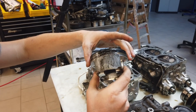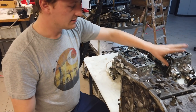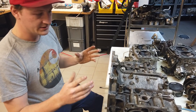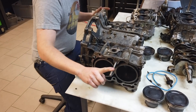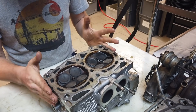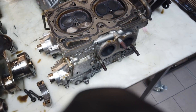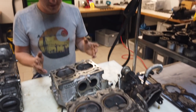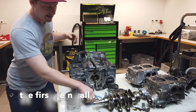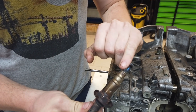What we have here is the standard piston ring failure. On cylinder four it's a little bit crazy because the engine was already opened before — it has head studs and got a new cylinder head. Here is the new head, and here is the old head. The old head has some cracks, and we don't know exactly what happened.